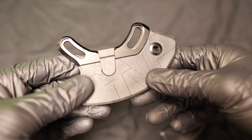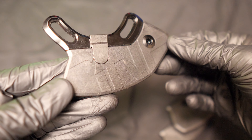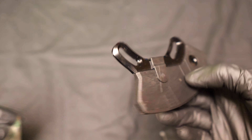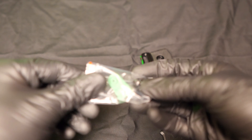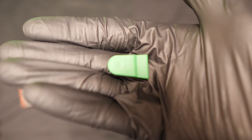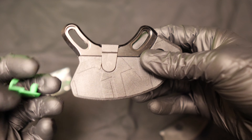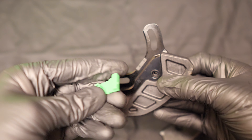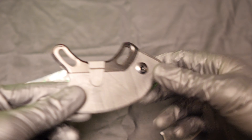These are oval ring compatible. You can see it's got the 1UP logo embossed into it. It's attached via these two five mil chainring bolts and it has a little cover over one of them. It comes with an additional cover in 1UP Components' customary green if you want to run that. To remove this you just push it out from the back and it unclips off the top, then use a five mil allen key to replace that.